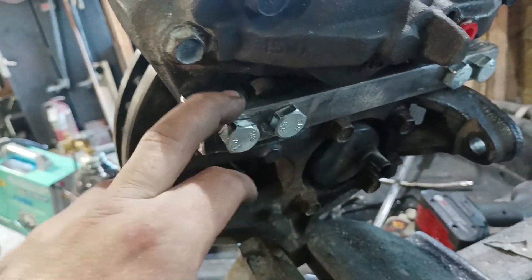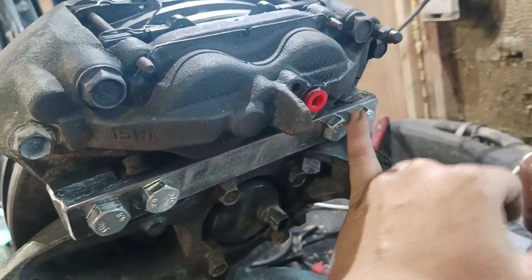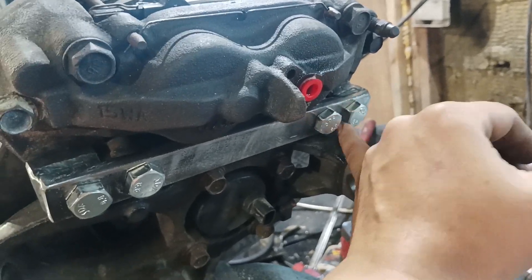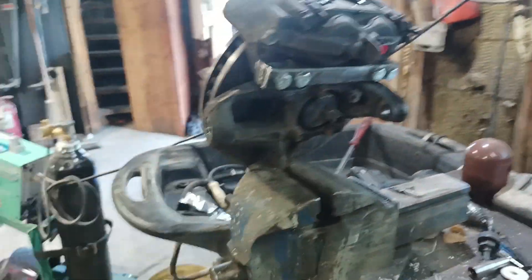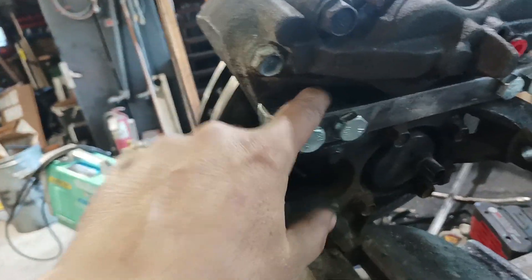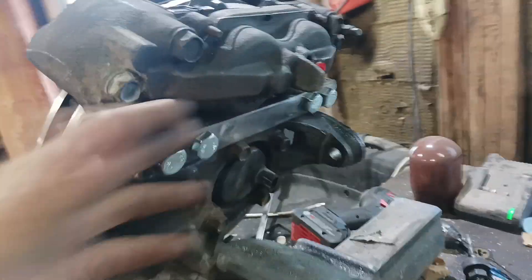It's got that form of physical rigidity to the knuckle — it can't wiggle or flex at all. With 3/8ths steel plus the 5/8ths added to it, you've got a lot of structure there. There's also a very small gap between the bolt mounting areas, so there's no real room for any mechanical flex. The ears of the caliper actually mount onto the ears of the knuckle itself — we're just spacing it off. So we should be golden.